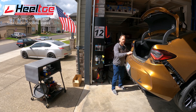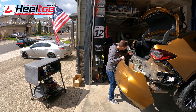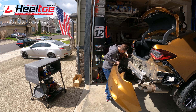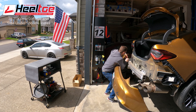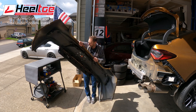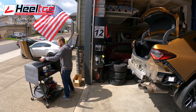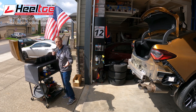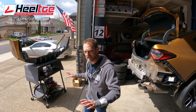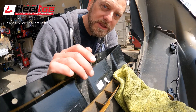Now we're just holding on by a thread here. Bumper is free - but before I go walking away, undo the clip. I got the harness disconnected from the frame, and then you can undo the harness from the bumper. Bumper off and free - I'm going to rest it up on my cart. Next step's coming.